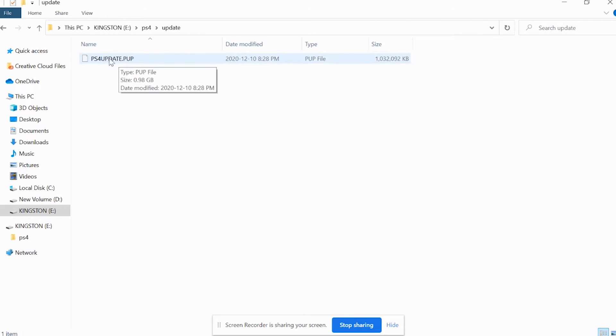There are two files at the link I'm going to share in the description. One file is to help the PlayStation to upgrade. The other file is to reinstall it — basically a factory reset — and it's going to erase all the information from your PlayStation as well. That is your last resort. If the update file doesn't work and you keep getting update error messages with no other fix, you may want to consider the reinstallation file. The file I have here is a reinstallation file.